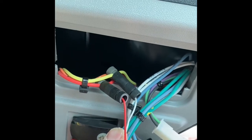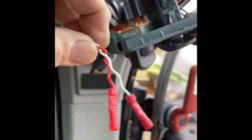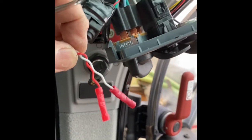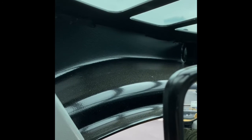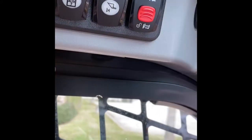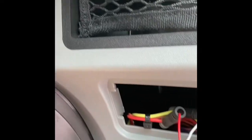We'll go ahead and just posi tap these in the meantime. We've got a couple red butt connectors on there because we have to feed the cable through the top up here, because our device is going to go behind this mirror on top of this metal shelf. It's a really good spot — it's inside, it's protected, and it gets great GPS signal. We also need to find a ground. A lot of times you can go right to the cigarette lighter, but in this case they're using USB, so we're going to go to that.